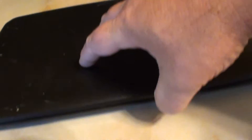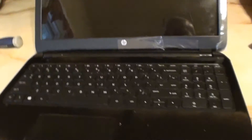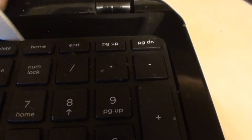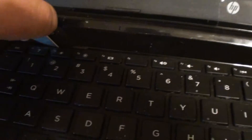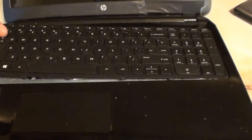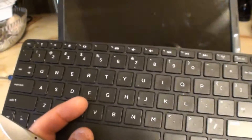So now, if your keyboard is the only problem — and believe me, I know they go bad, I just can't believe how crappy they make these new cheap laptops, they're really garbage — you just take them out. Then you get yourself a little edge here and just get down in between the actual keyboard and the housing and just start popping her out. It's really quite an easy job. Pull it out, and then you just have your ribbon cable right there. All you gotta do is flip this up, pull your cable out. Bam — keyboard done.